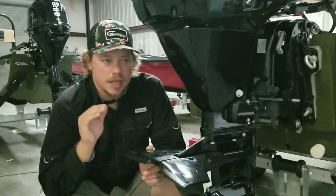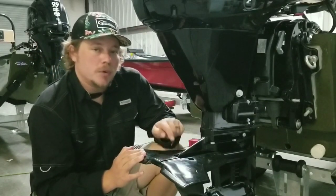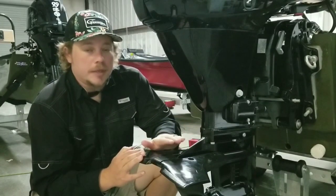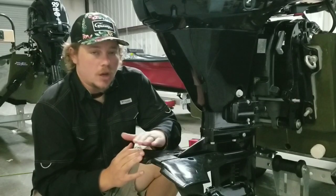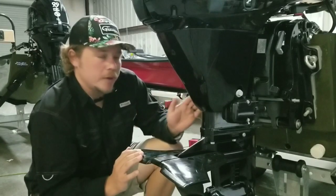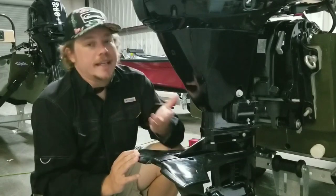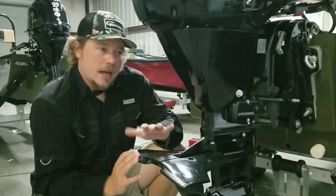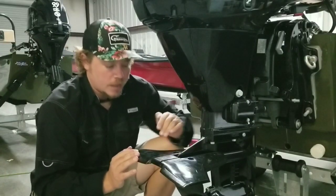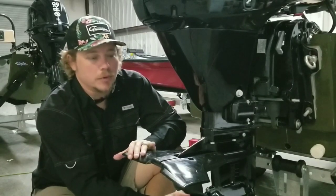It's at a perfect trim. Everything's moving exactly like it should. If I add a hydrofoil to it, I'm going to lose some of the efficiency moving forward. Now I'm going to get on plane faster, my hole shot's going to be better, but the downside is I'm going to lose some top end. Now on this boat, because I was never able to trim it up completely, I didn't lose top end, I gained top end. Another thing that makes a hydrofoil really nice is when I'm running, it's pushing the water to the prop, so I'm getting more water flow to the prop, making it more efficient.